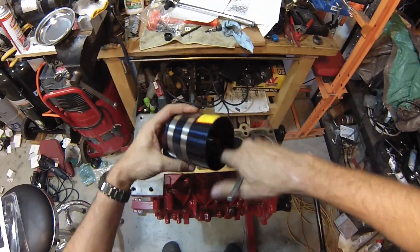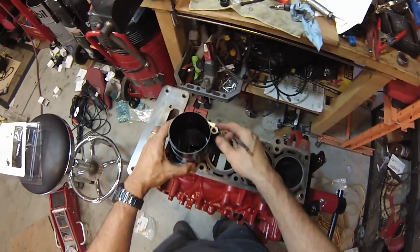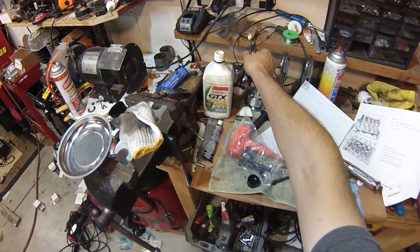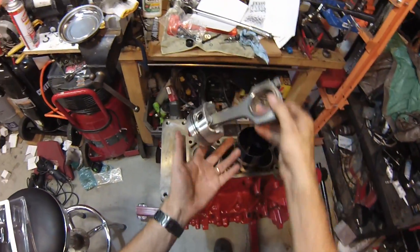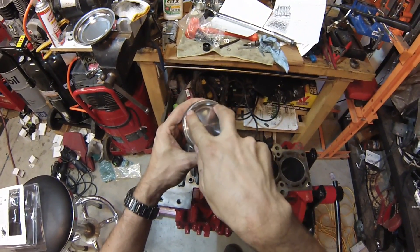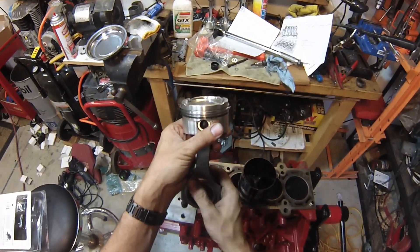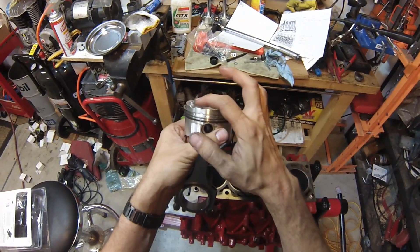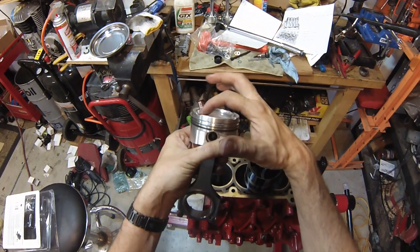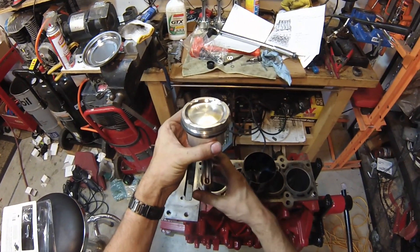This is not the best tool to do this — it's what I was able to find for a reasonable price. Basically you put the piston in, squish it down, and then shove it in. So I'll grab piston number 1 here. On the top there's these little eyelets with an indentation where the valve fits, and one side is a little bit deeper than the other side. The intake valves are larger, so we want to make sure that the larger indentation is facing towards the intake valve side. I'm going to double and triple check this about 100 times.